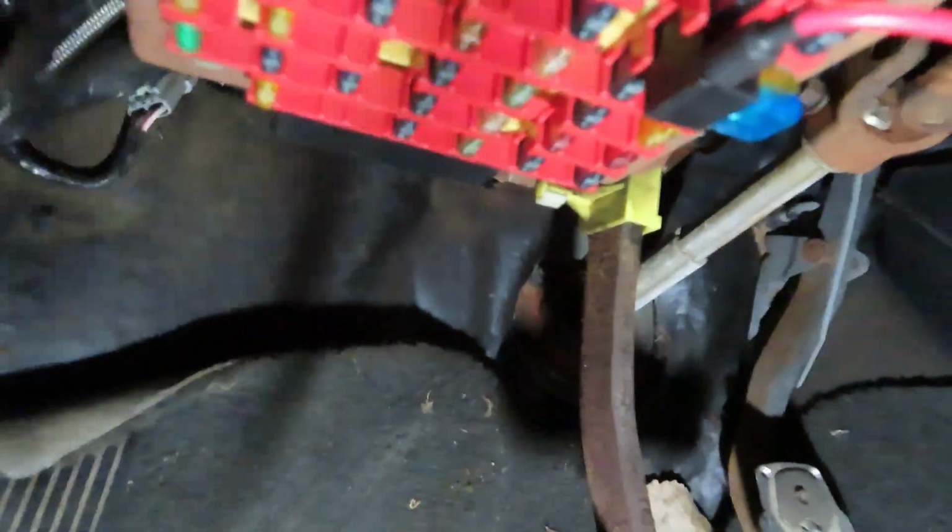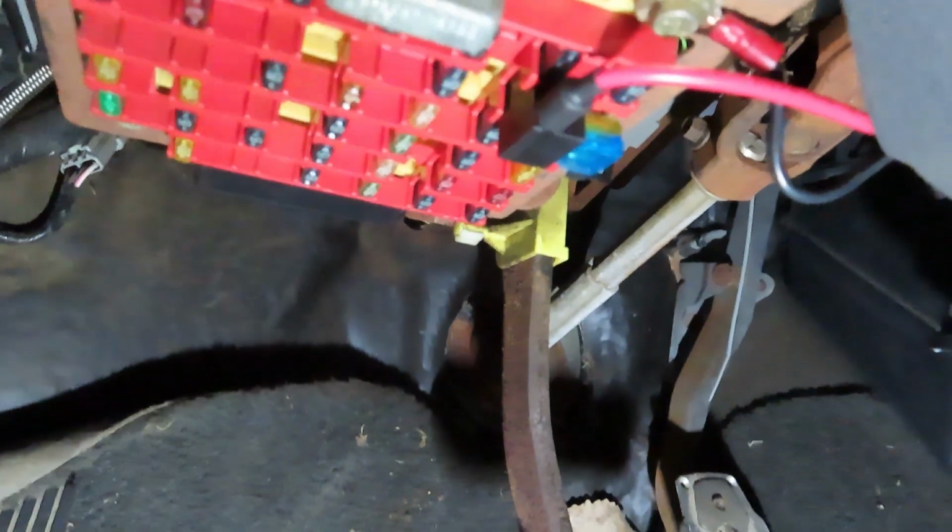And then we did a no-no and ran our nitrous feed line through the interior of the car because I don't care. And then we started pulling our key-on switch. I picked up these little fuse taps. I don't know if you guys have seen those, but those things are really nice for getting everything wired up. Not as janky as it used to be. I used to pull out fuses and jab a wire into the fuse spade, but I have grown a little bit since those days.